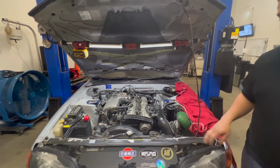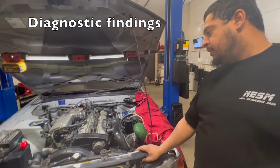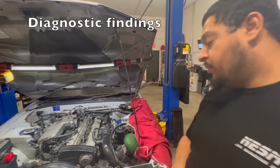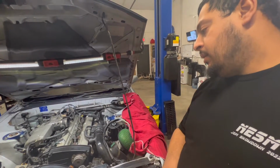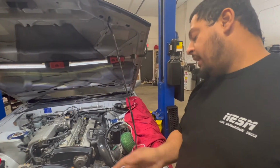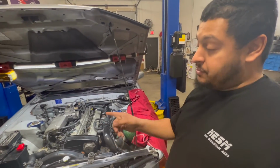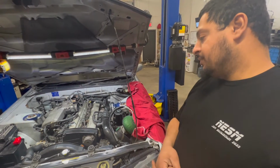So you did your diagnostic. So found a couple things going on. Got a couple oil leaks, valve cover gaskets are leaking oil. The water pump shows that it's been leaking through the weep hole, which is a sign that the water pump is failing. So at that point, while changing the water pump, we're going to do timing belt, idler pulleys, and alternator belt and things of that nature. The upper control arm bushings are shot, so the driver's side wheel has a ton of play, and some maintenance and fluid services along with that.